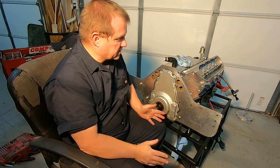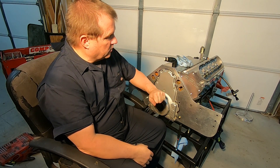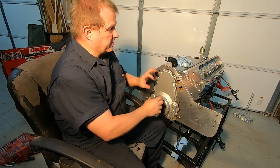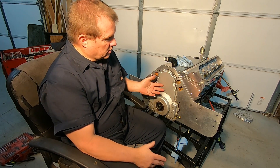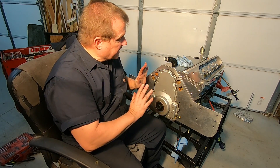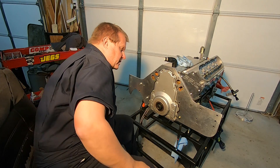In order to make this swap happen, there are a couple pieces and parts that we're going to have to do. One of the parts is we're going to have to swap out the timing cover — that's one. The other is the cam sprocket — that's number two. The third part we're going to have to get is the cam sensor. So basically, I'm going to have to get three parts to do this. But in order for all that to happen, I'm going to have to remove this timing cover. Let's go ahead and get that started.